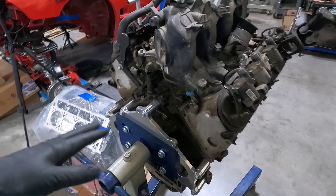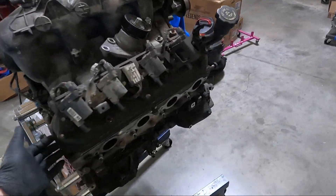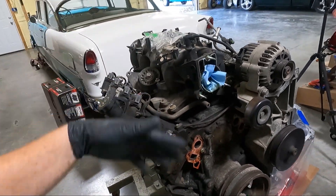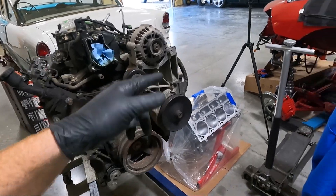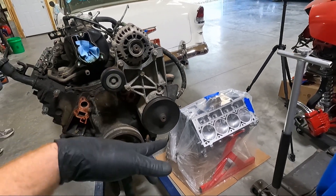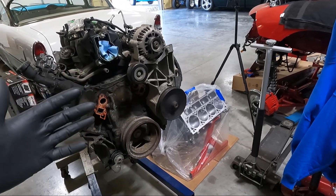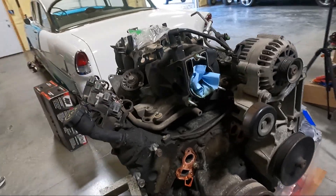I was going back and forth on whether to run the 317 heads I've got on this donor motor pulled out of the truck. This is just a stock LS1 block, so we know we're not trying to make gobs of power — the block is the limiting factor. Here's the plan for today's video: we're going to take all the front runner stuff off, take the intake off, take the valve covers off, get the heads off, get them shipped out, cleaned up, ported, and resurfaced. The compression should be close to 9:1 with those heads and the LS9 gaskets. I just didn't want it to drive like crap out of boost — that's why I went with that piston.